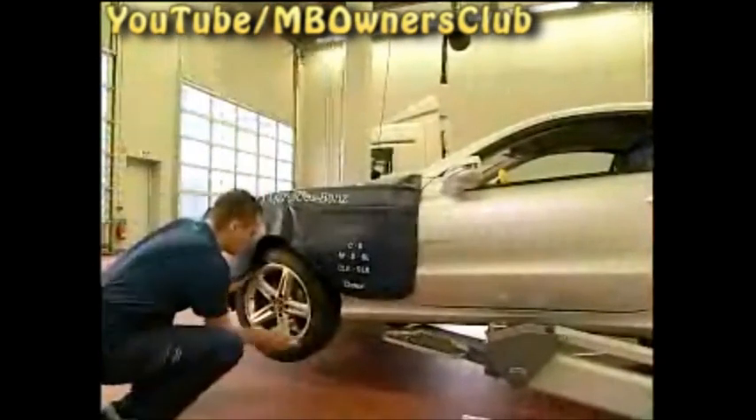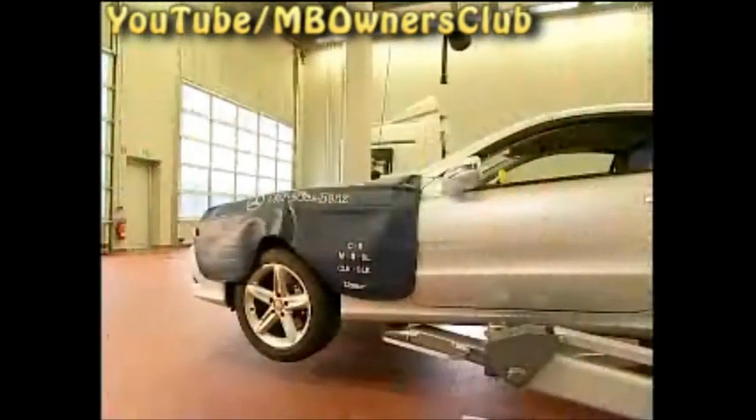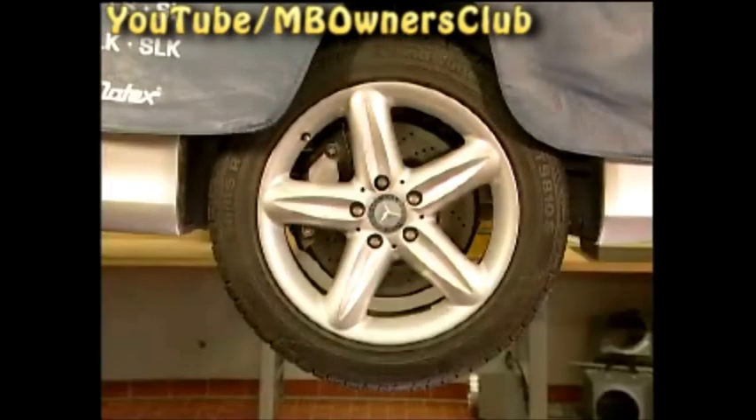A maximum of 60 seconds after the rear wheel, the front wheel is next. It must be turned with an approximate speed of 1 to 2 revolutions per second until it stops independently. The tail light will flash 3 times to confirm the activation. The application routine is started and the front and rear brake pads are applied several times. Now lower the vehicle again.